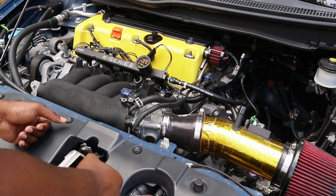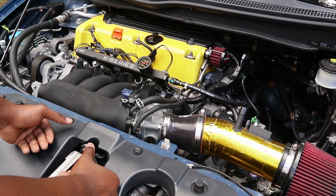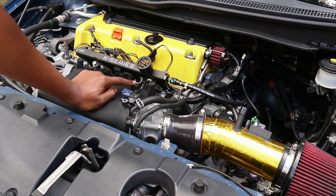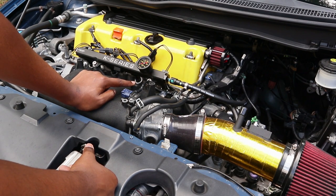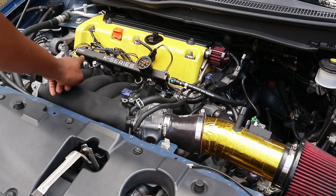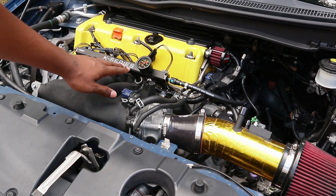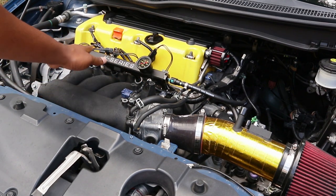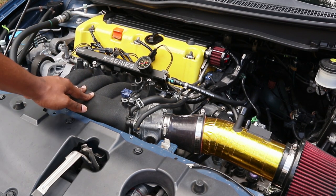I've been saying in a bunch of my videos that I really hate how the wire harness looks in this car. I don't really know how to do this but I'm gonna give it a shot. I'm gonna take off these two grounds and try to mount them up right here. I do have some washers I could put as the ground. I'm not too worried because I'm using plug-and-play connectors, so the wires can hang below the RBC and still reach the injectors.